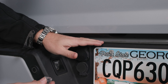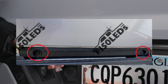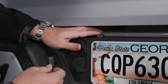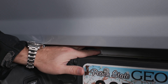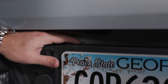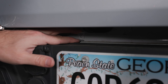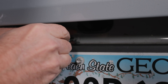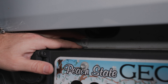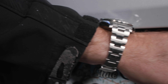If you're installing on a Super Duty, you may have a center pad, and you can remove that using a Torx 20 drill bit. Now let's go ahead and mount these. You've got six brackets. I'm going to use the bottom lip as a guide and try to mount it in a flat spot — if you go all the way down you can see it has a curve — so I'll lift up slightly, mark the center hole, and repeat that process for all six, then mount the brackets so we can mount our bar directly to the truck.